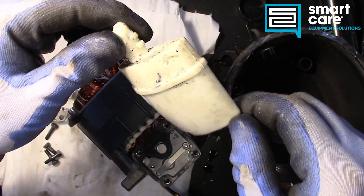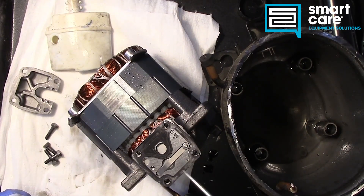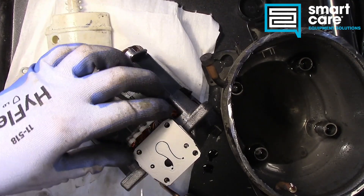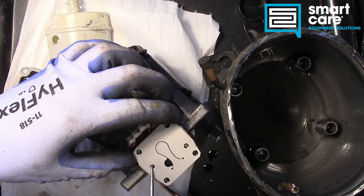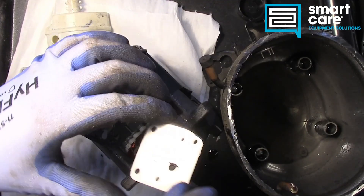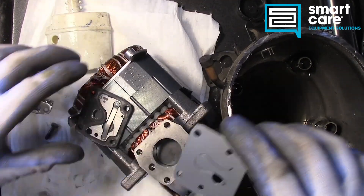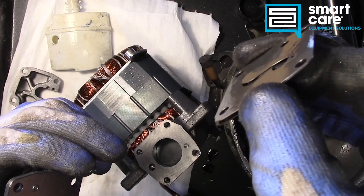It's got a little drain hole in the bottom of it too. They're trying to make sure you're not pulling liquid in. The reason that's so critical is our valving. This is our valve plate — we can pop this loose and you can see there's an oil film on it. The valving in a compressor is really critical. If this valving gets damaged, wears out, or cracks, this is one of the main failure points. The motor still runs, the compressor still kicks on, but it's not able to effectively pump anymore.